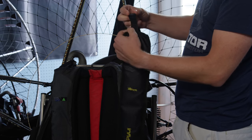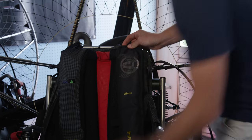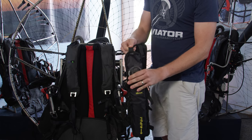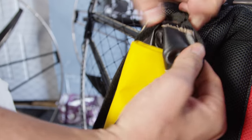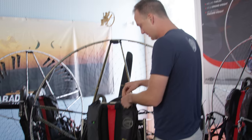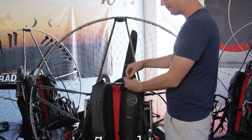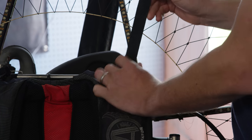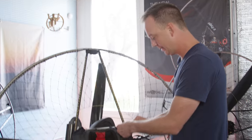This piece is your buckle, and it's very important that you leave enough space so that you're not using this as a retention strap — you don't want to carry the weight of the motor on your flotation. If you do, you'll end up with some fraying right here. When I first installed these, I had it a little too tight and ended up carrying the weight of the motor on that packaging. It doesn't affect the actual flotation device inside the sheath. So on this left one, take this strap and slide it through the top bar on your frame. Leave a little extra slack — it does not need to be super tight, because when inflated it's going to ride up and keep my head out of the water. Thread through the bar, back down, and tie it off to lock it in place with no movement.